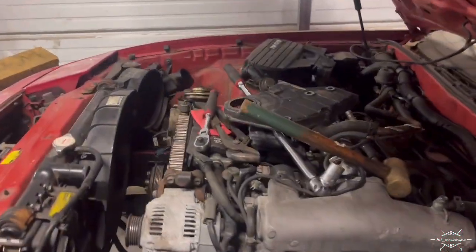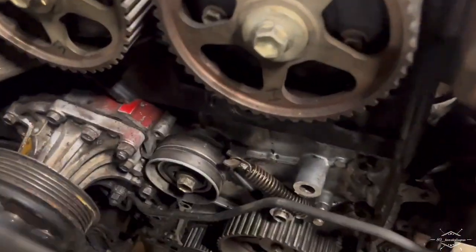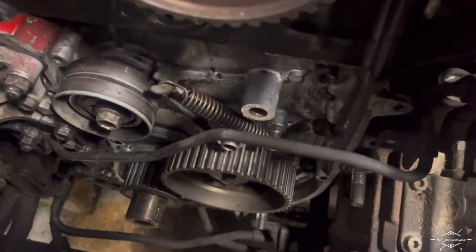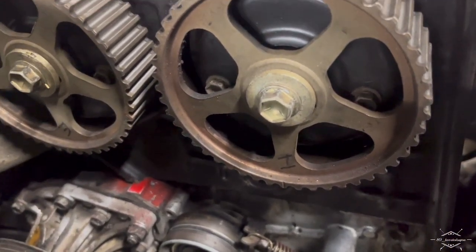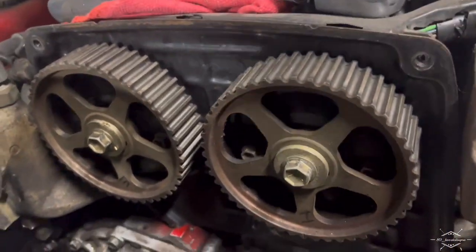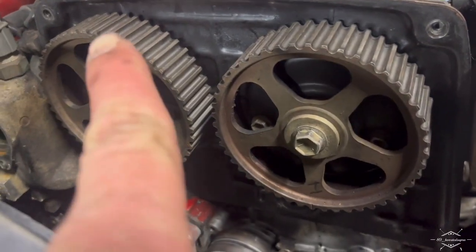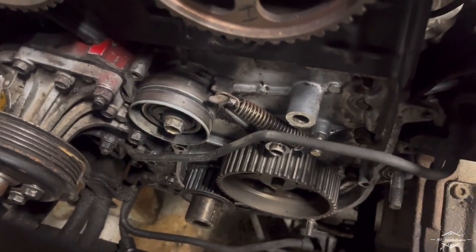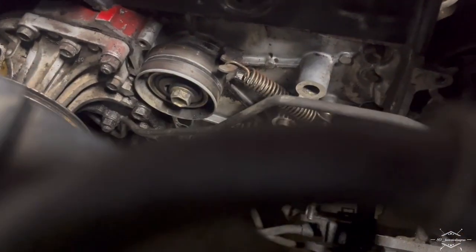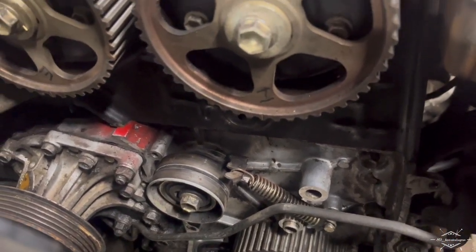So I'm about done with this for tonight. I don't know if Andrew's coming or not. I just want to make sure there weren't any more pieces in there. So I'm going to get all this stuff set on top dead center. Of course, these cams have got to be up here, and that one's the same way — it's got to be up there. Then we'll get the crank on the thing. That way, when we get the belt, all we've got to do is put it on. I'm going to check all these bolts and make sure nothing's backed out that I can't see.